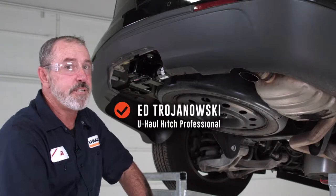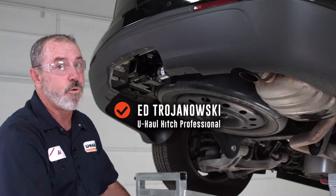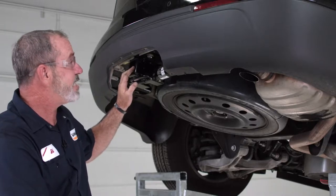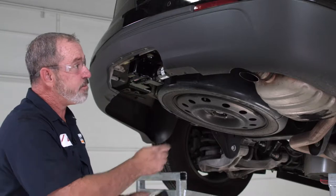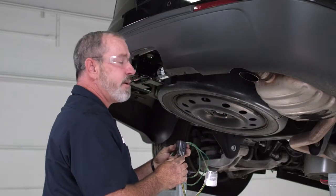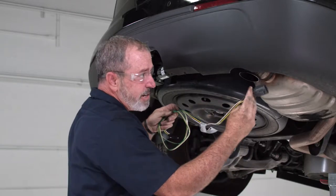If you're going to be using your Chevy Traverse to tow a trailer, you're definitely going to need to get a trailer wiring harness installed on your vehicle. One good thing about the Chevy Traverse is that when they designed the vehicle, they designed it for towing. They did put an OEM harness for towing right up here behind the fender well. It's a little connector and the wiring that we're going to install has the mating connector — I'll go ahead and click that in right now.